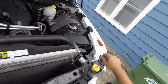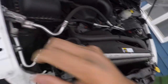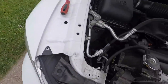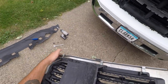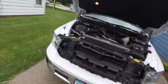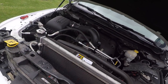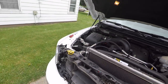Keeping your hand behind here, pop that back. Now we'll remove this metal clip as well. And now it just has the bottom held on. So we're going to come back here, same thing — push from the back. And that's it. So this is the clip I was talking about, and then you also have these plastic tabs as well. The grill is out. What I like to do is go back and put all the screws back in where they came from, so that I don't lose them — just kind of thread them in a little bit.